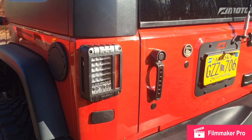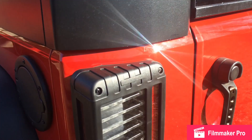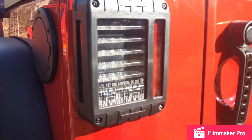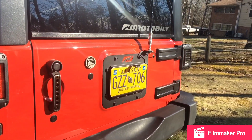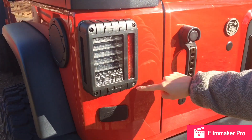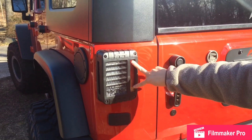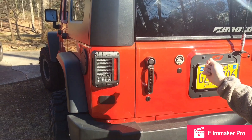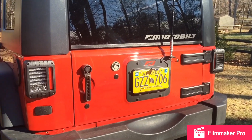We got the stock ones off and the Lightway tail lights on. As you can see, they're a completely different look — much sportier, in my opinion, and really makes the whole tail of the Jeep look so much better. A few things to note when you are changing them: make sure you clean out all the excess dirt around the edges, because the frames are a little different. Just take the two inner screws off, pull it off, pull out the plug, put the new plug in, and re-screw in the new tail lights. It's pretty much that easy.